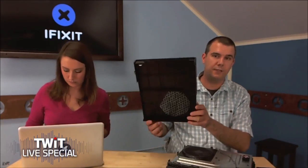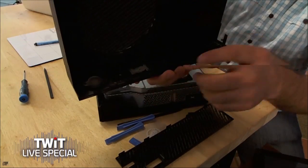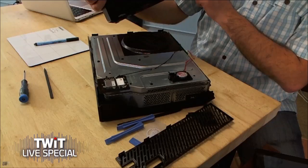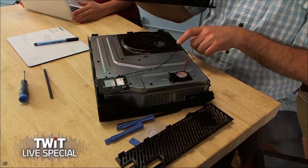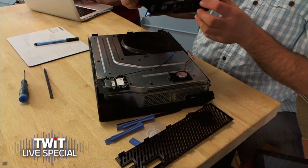An exclusive: the buttons on the front of the Xbox One are touch capacitive. There's a button for eject and a button for turning it on — they're not physical buttons, they sense your finger like an iPad. There's a cable that routes through the front which is very precarious. If you just free all the clips and go boom, that cable comes with it and you'll probably damage the front daughterboard or the cable itself. The eject button — you just touch it and it ejects the disc.